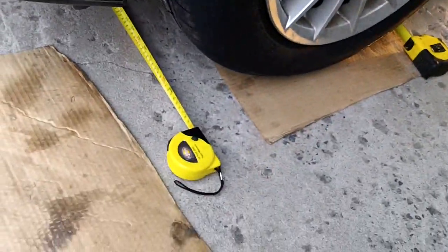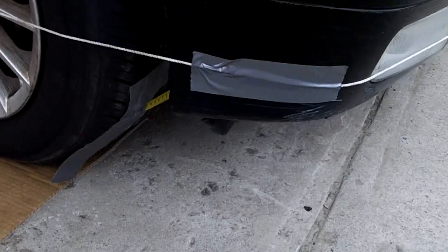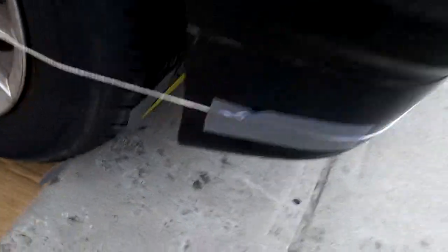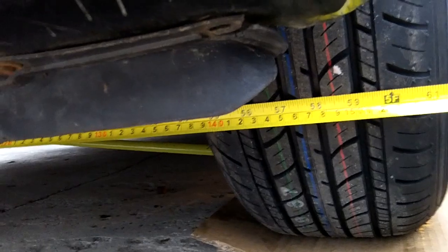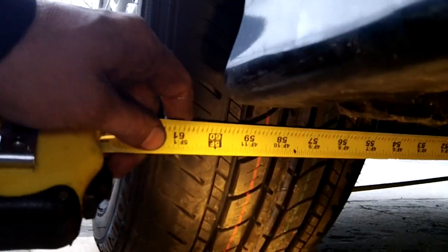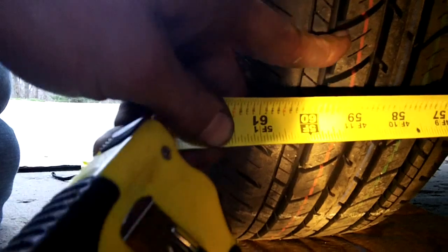Okay, here I have the car set up with a string. I got two tape measures — one in the front of the tire. I got no help tonight; he's fishing. I basically just got the front end of the tape measure duct taped to the tire, that way it doesn't fall off and I can do it myself. And quite honestly, any day you can use duct tape for a new application is a good day. So in the front we got about 59 inches. In the back of the tire we'd want about 59 and an eighth. And in the back we have just a little under 59 and an eighth — so we're pretty close.